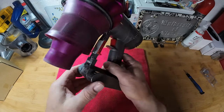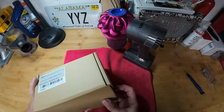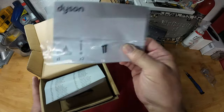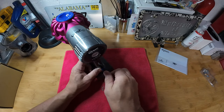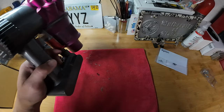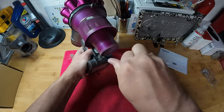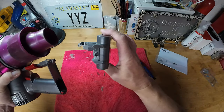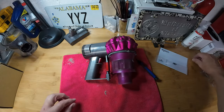The screws are very small. When you get your replacement battery from Dyson it will come with two new screws — there they are. We're going to take the old battery off first: there's one screw, and then the other one up front here, which is why we took the bin off. That's two screws out and then the battery pops out like that.